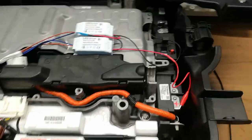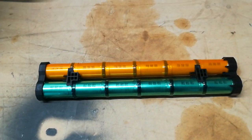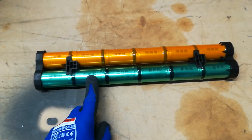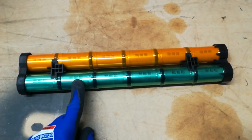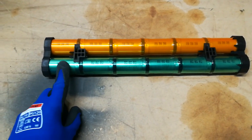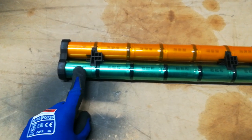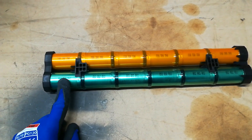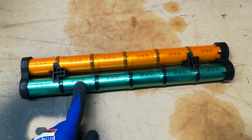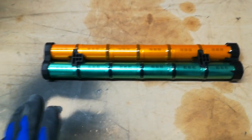Leave it on for at least 24 hours. It's a very low current charge that will slowly and gently balance the cells. Imagine one cell is nearly full and another is nearly empty — the car won't like that and the state of charge will swing quickly. We apply our gentle charge; when the full cell reaches 100% before the empty one catches up, it just slowly and gently heats, converting excess energy into heat. Because the current is very low it doesn't overheat. Eventually after about 24 hours the cells will all be balanced at about 100%.